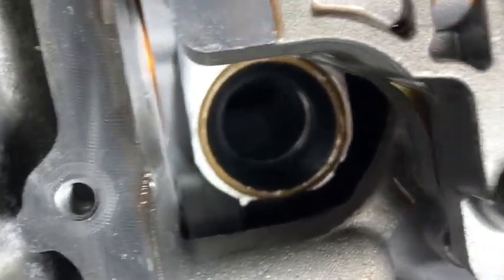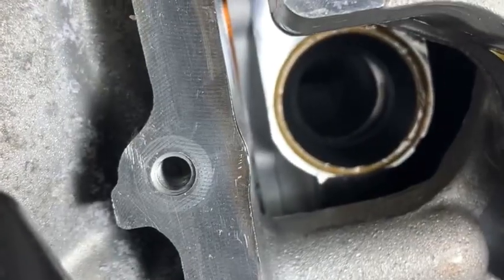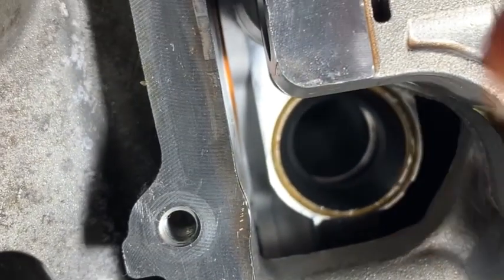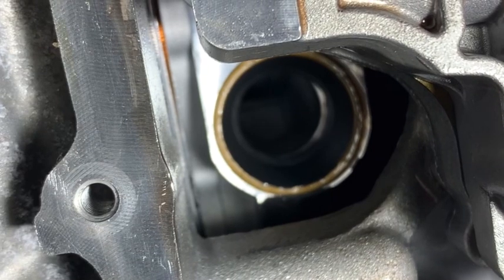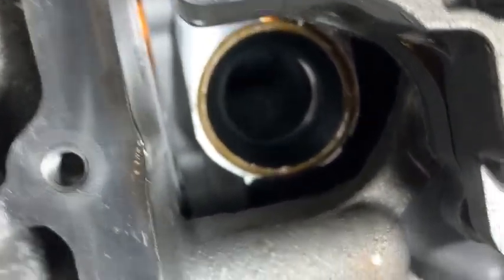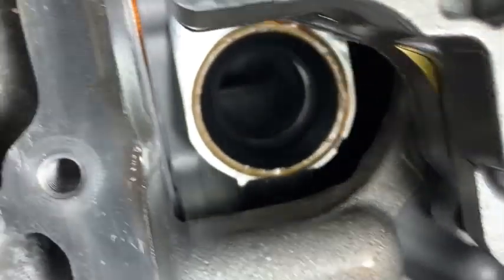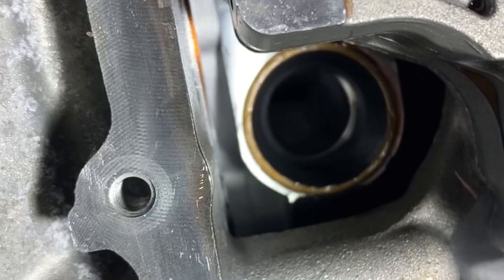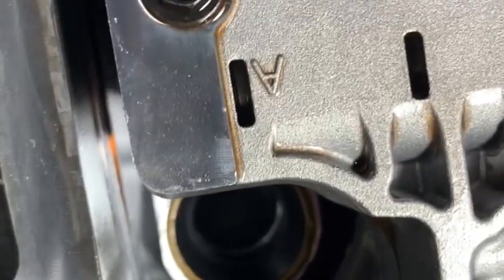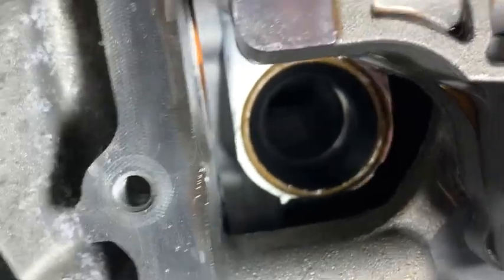But anyway, then he just drove the seal in there. You can take a socket, flip it over backwards with the drive side towards the seal and just stick an extension up in there and tap it in. He just tapped all the way around the edge of it with a socket and extension to drive it in. But anyway, there's that. I'll rub a little bit of fluid around the seal there just to lubricate it up, and I'll put this other filter back in.